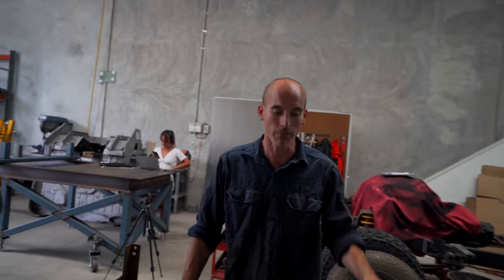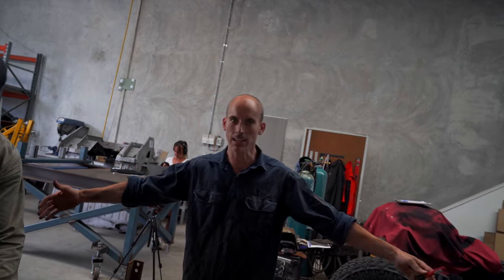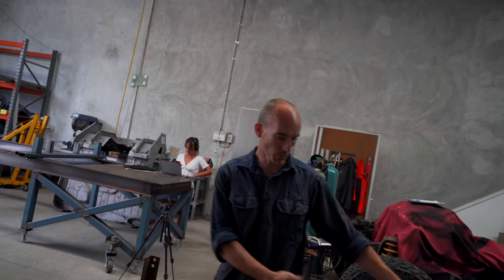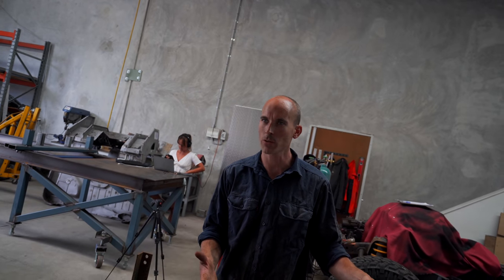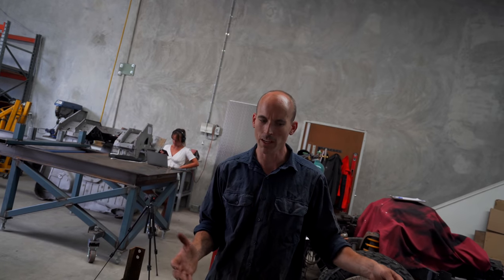So they're 400 kilo constant load springs, but they're designed to have a tray that hangs right out the back here. So obviously we're going to move the wheelbase further back, which means we're going to have less tray hanging out the back. So they might not be 400 kilo springs then, they might turn into 600 kilo constant load springs, just because the position and the weight's different.